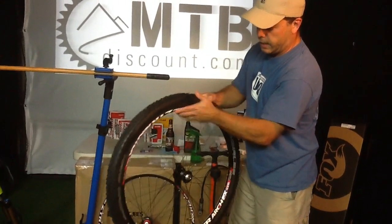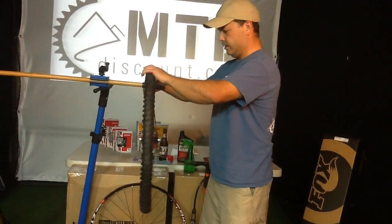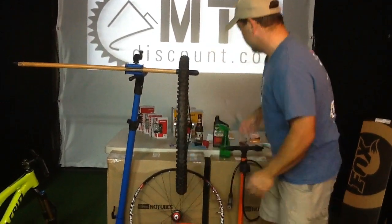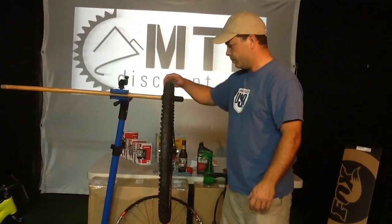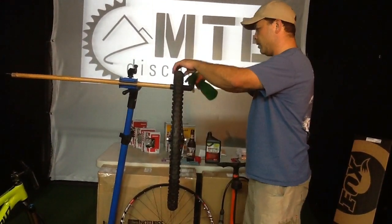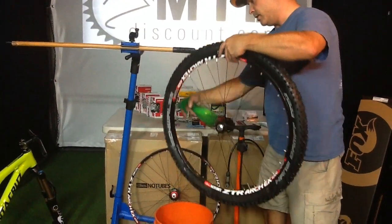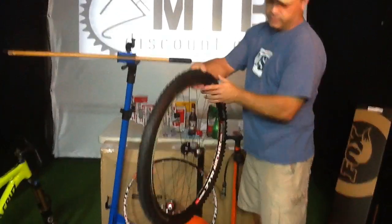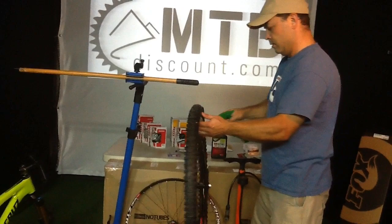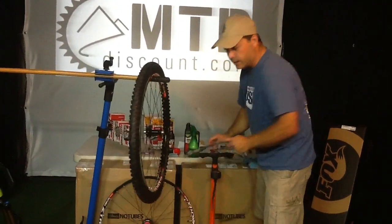Usually you can get it done with a hand pump. If you're having problems with the hand pump, of course you're going to want to try using a shop compressor and get it done that way. But with running only 40 PSI in these smaller tires, it's a little safer and a little less hard on the tire to run a hand pump. Now that we've got it kind of set up, we're going to take our soapy water and spray it right around the edge here. Allow it to run through — what this does is allows the bead to slip off and seal nice and easy. You're going to want to do this somewhere where you can make a little bit of a mess, as you'll have soapy water and sometimes sealant dripping. Just run it around a little bit so you've got soapy water on all the edges. You want the valve down at the bottom generally, because any sealant that may have worked its way up, you don't want it to end up in your floor pump.